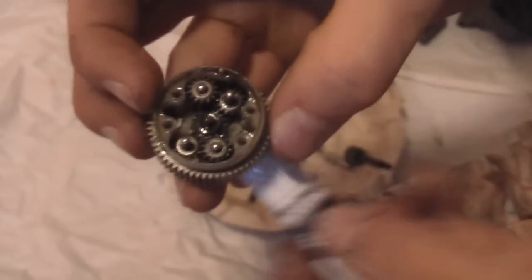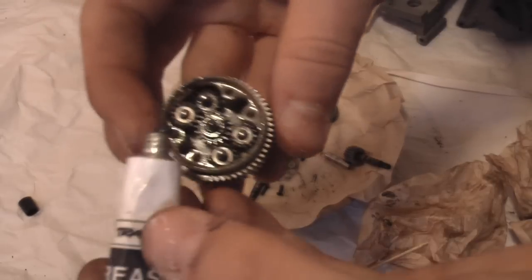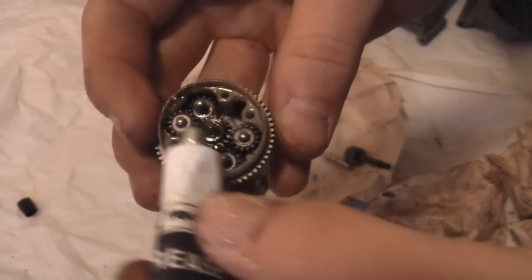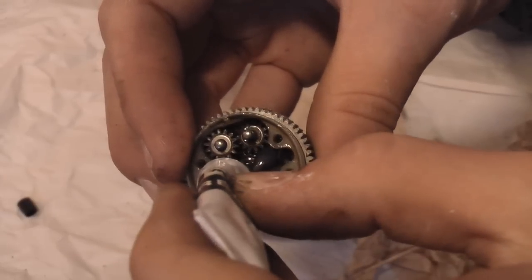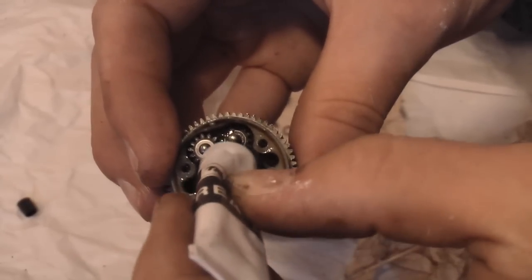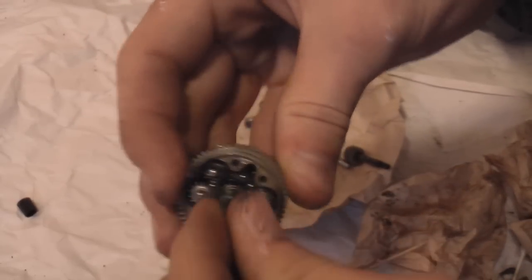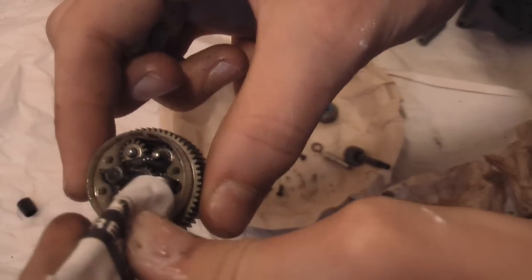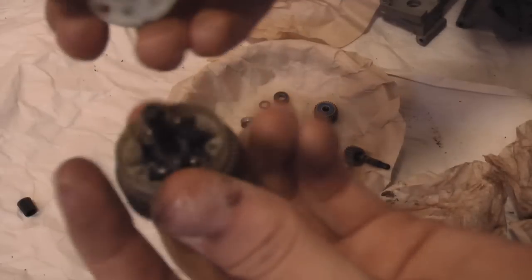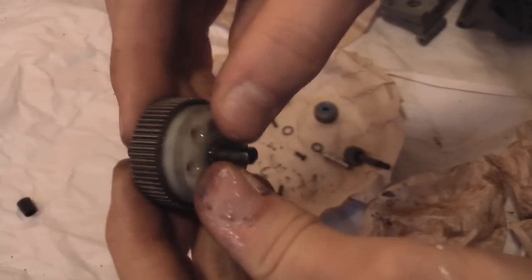Now that I've cleaned out my diff, it's time to put some grease in it. Use silicone grease — you don't want to use lithium grease like I used to have in it. Fill it anywhere from about a third to two-thirds full; I'm going to fill this one up about half way. Then take the other side and push it down in there. Take the plastic top part and put it back on — actually I'll squirt a little bit more in since it'll spread out to the edges. Then take the top plastic part and screw it back on.